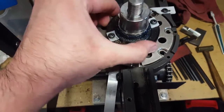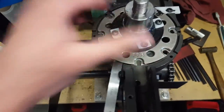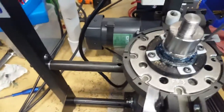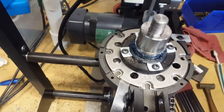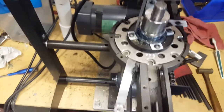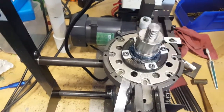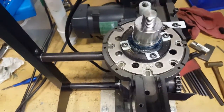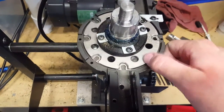You might get a little more tightness out of it — that's fine. Just tighten it down finger tight. Go ahead and grab your handy dandy Allen wrench, give it a little twist. It doesn't have to be over tight, just a snug, snugging measure. And then once you're all said and done, pull out your feeler gauge. What you'll have is a perfectly set up shell plate.